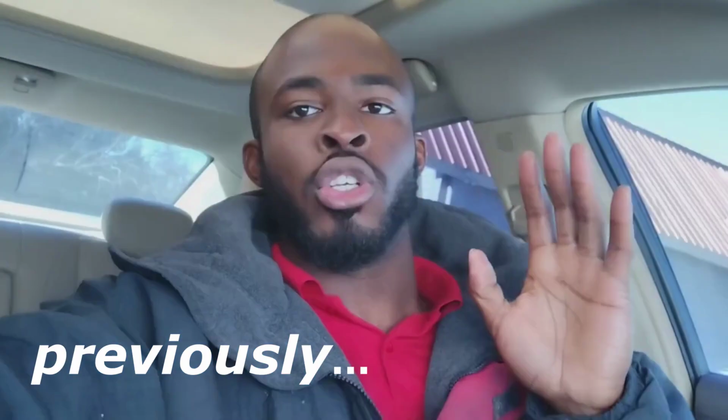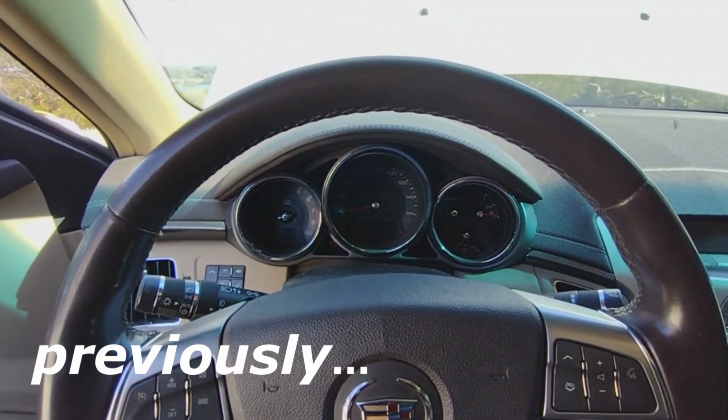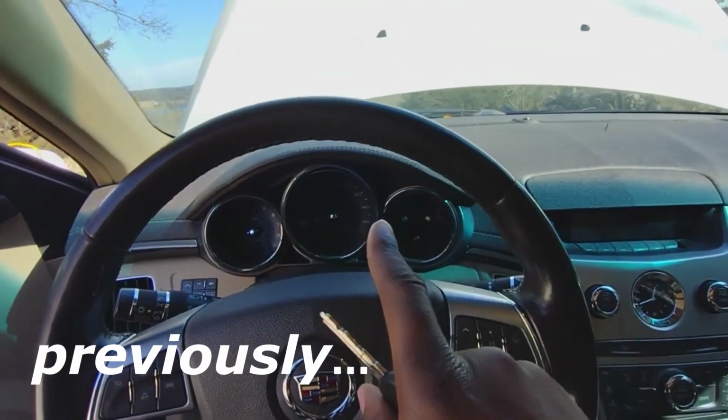Random misfire. So the short version of what this scan tool is telling us is that the timing is off. We have misfires on every single cylinder. Okay, that wasn't a whole lot, but you could hear the skip.